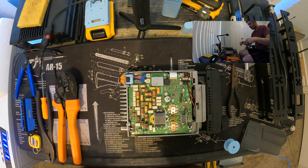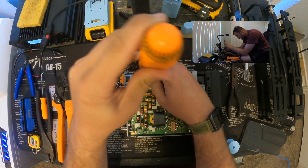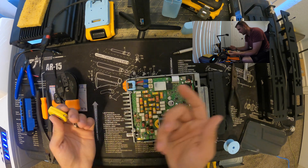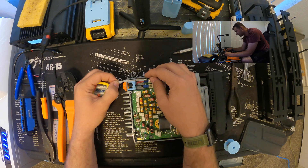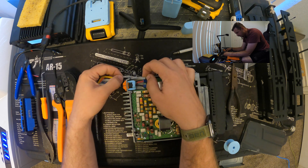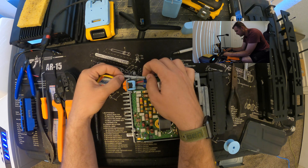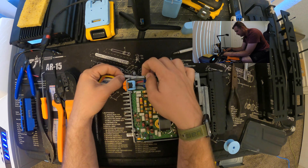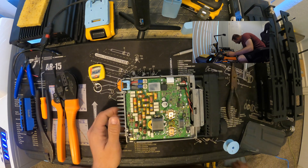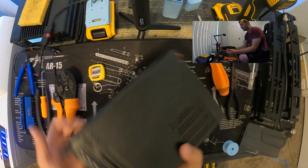Be aware this is 3D printed plastic, so once it's set it should be fine, but don't strip it. After fixing my screw-up and re-terminating, check your orientation - red should be on the left for this termination at the board. Snug it down; it has a lock washer, so don't try to snap it off the board. For wire measurement, from your part right there I'd say five to five and a half centimeters, or about two to two and a quarter inches - gives you a little leeway and you can fold any excess in.